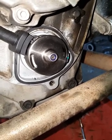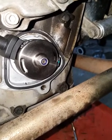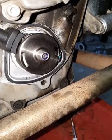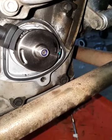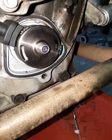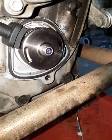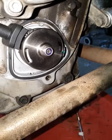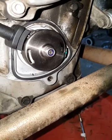The kit is very well engineered and very simple to fit. What you can see there is the shutter, and there's a new seal around the housing that comes in the kit — it needs to be super glued or siliconed into place and cut to length. All that's on that whole system is just a plate, which is exactly the same operation as a points plate, and on one side of it is the hall effect trigger. You can see the stainless steel shutter disc there that triggers that unit.